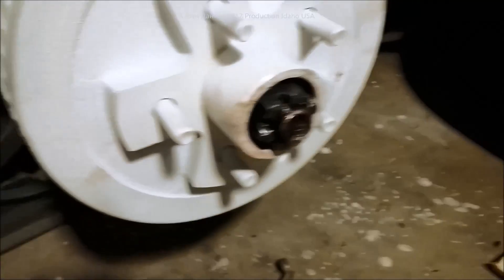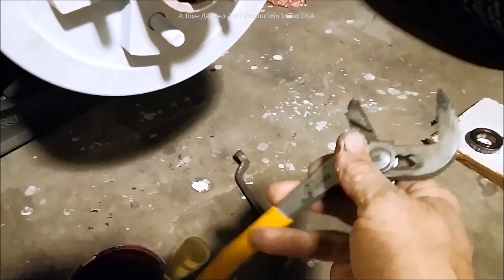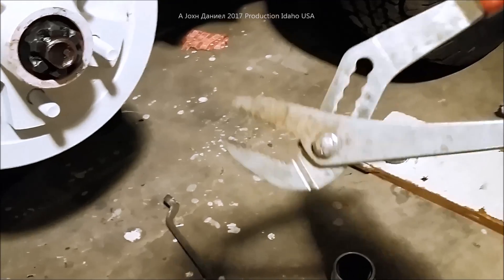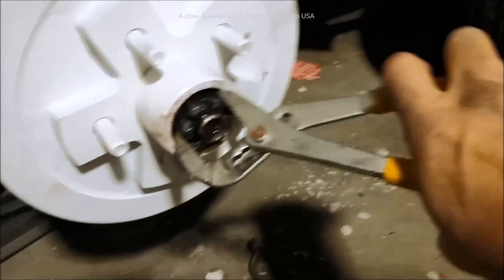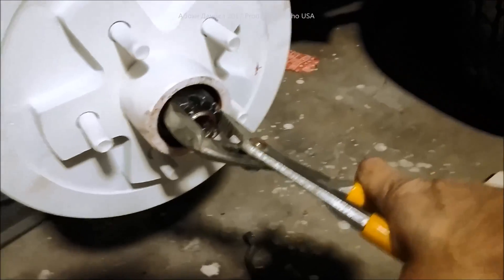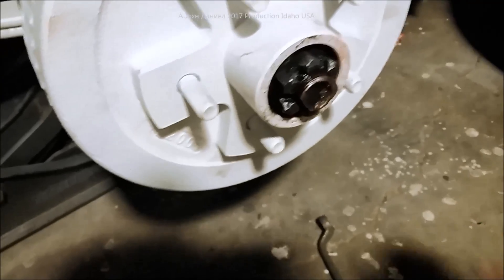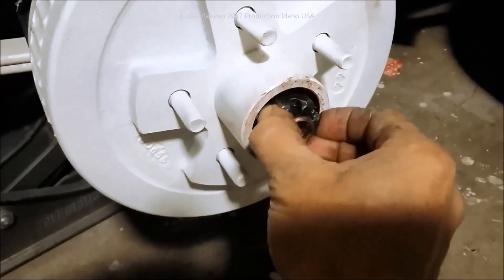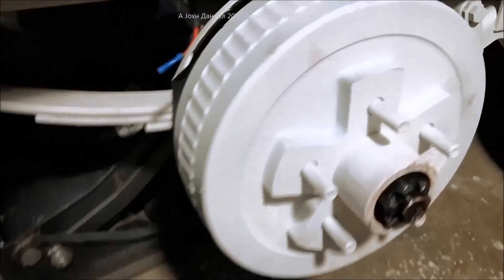Get your castle nut put back on and just get it to touch, then push back on your brakes on your hub so your bearing doesn't fall out. I'll just tighten these up — and by the way, here's the other pair of pliers, Pasco Reed, Reed Manufacturing, made in the USA. I'll get you a link to both. Look at all that weld splatter — hasn't damaged them one bit. I use these a lot. I walk it in a little bit, give it a little spin, then back off enough to get my cotter pin in the next hole back. With new bearings, it's okay to be pretty firm when tightening down, as long as you back off from full contact about a good quarter turn, then get your cotter pin in.